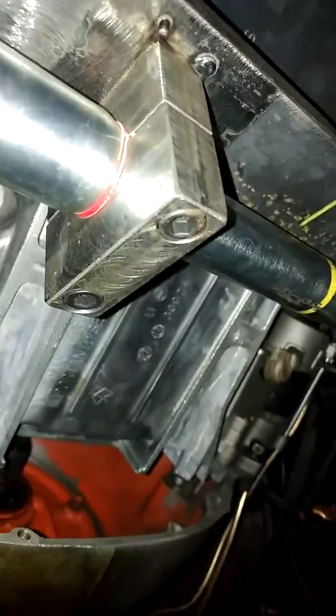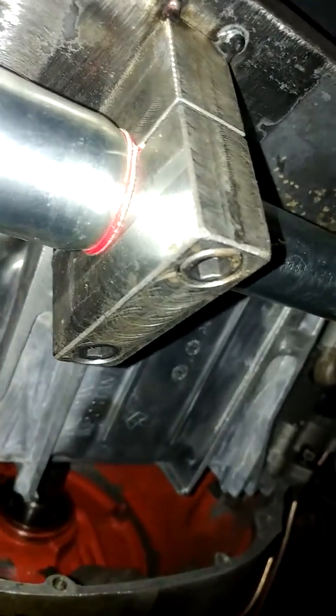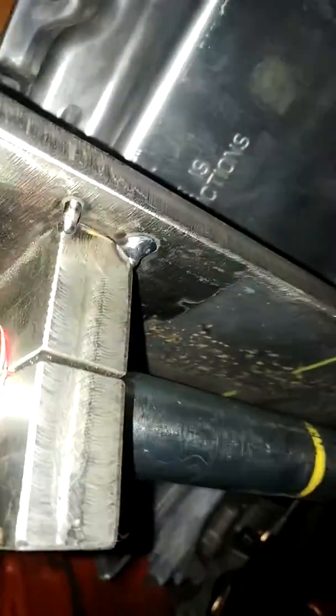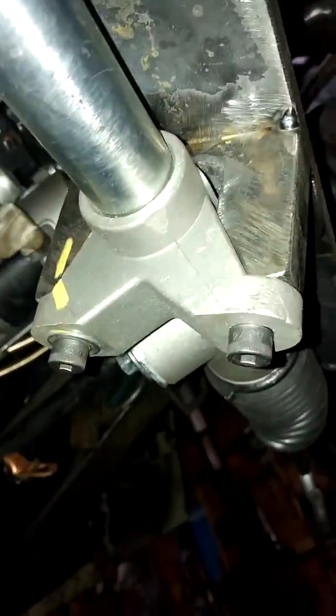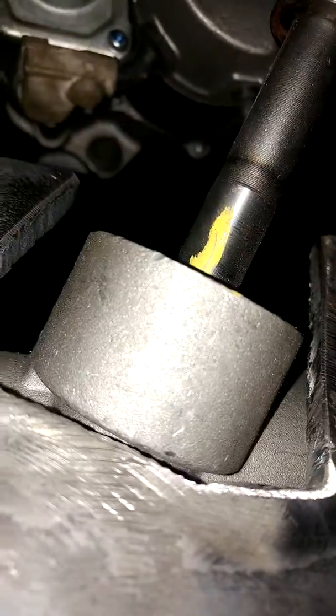Well, you kind of machine that U there for the rack to bolt to, and then I machine that plate there. That'll get welded to that. And I got 2 bolts up in there. There's a couple rafts of silicone on there because the hole, I made that bracket for the other rack, and the tube on this rack is a little smaller, so I had to make up the slot, but that'll all get welded out. That thing all fits in there, it's all tapped and everything, and should be golden. Little cutout there for the steering box itself.